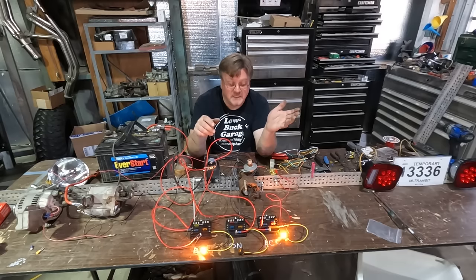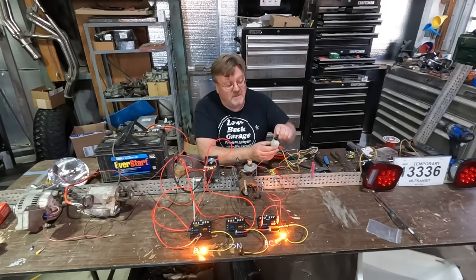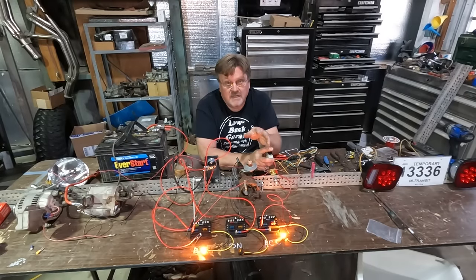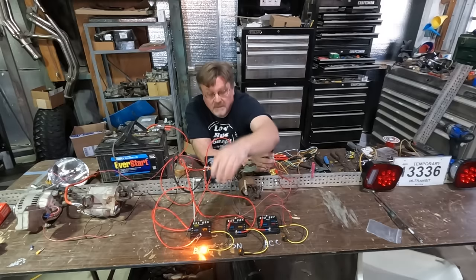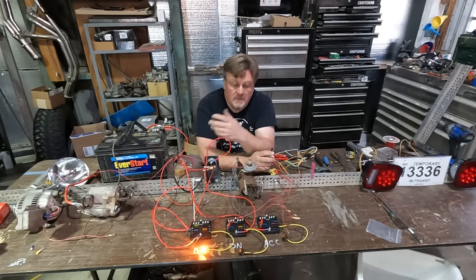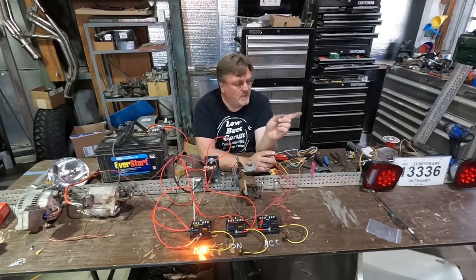Since we have headlights and taillights, we're going to need brake lights next. Here I have a brake light switch — a pedal switch operated off the physical brake pedal. They also have pressure switches that go in your hydraulic brake system and just sense the pressure — that's the style this truck has, just a pressure switch on the master cylinder. You can hook these to whatever you want. Brake lights are one of the most important things you've got going — particularly the ones with flashing lights behind your car would frown on you not having them.